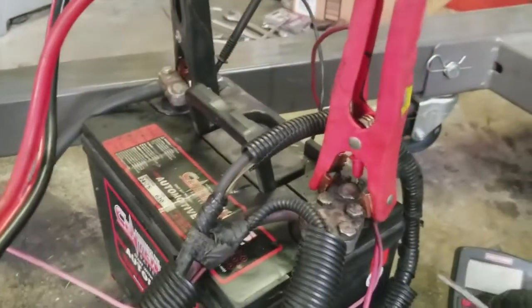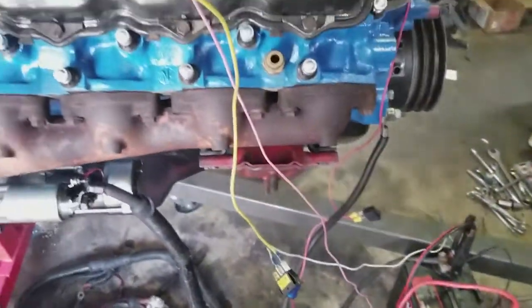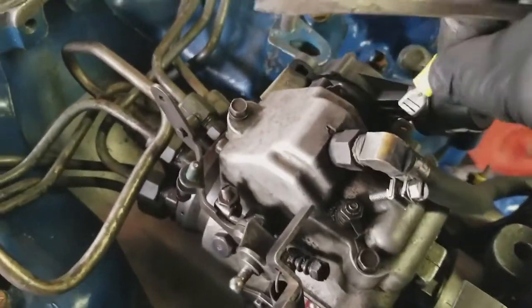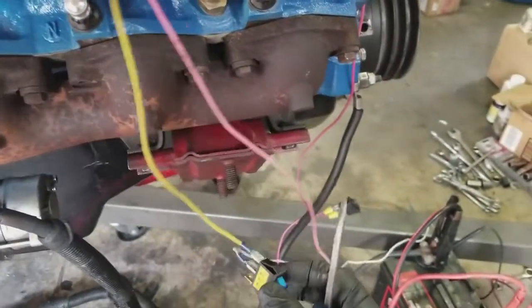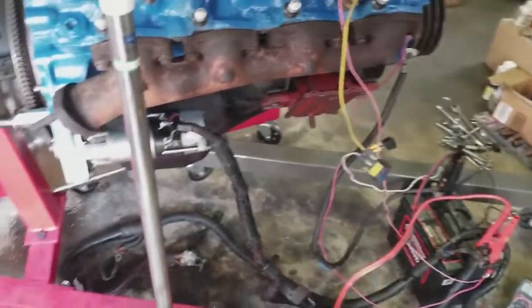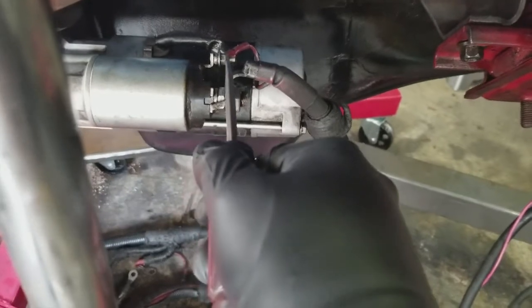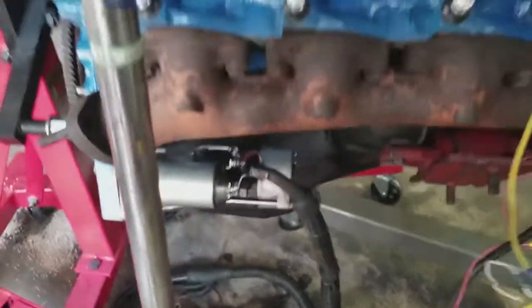I lost my voltage — hold on. Alright, I'm at 13 and a quarter almost. This might start. To get it started: get your throttle ready, turn on your fuel solenoid — you can actually see a little spark there — you can hear it clicking and there's a spark, so you know it's getting powered. Turn on the fuel pump and you should be able to hear that clicking as well. Then you're going to touch the two contacts together. You want to hold it firmly because the engine's going to shake and that shaking will make it difficult to keep constant contact. Alright, I'm going to put the camera down and see if I can do this.